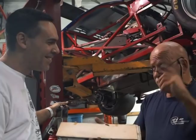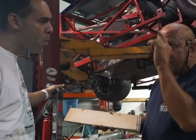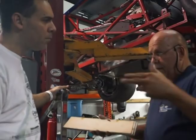Back then, they even knew what the drag racing guys were doing. They put in extra dowel pins and stuff like that. I've got some rotor housings that have an extra dowel pin hole with an O-ring, as if it was meant to have one. That's how they came stock. So maybe that's where that idea came from. Then they eliminated what wasn't necessary.